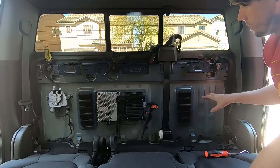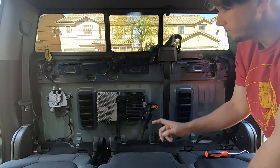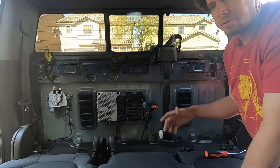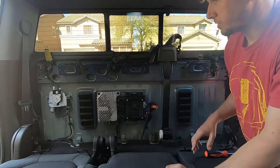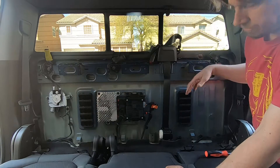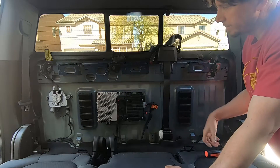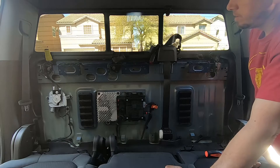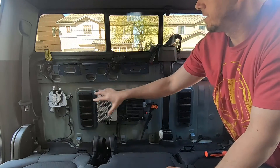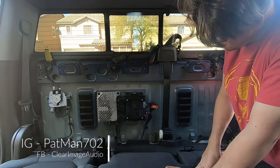I'll do the two amps over here and get rid of one vent — one should be enough. Those flaps are for when you close the door so you don't get that ear-popping pressure in the vehicle. They stabilize the pressure, and they all angle down so if water gets in between them it just drains underneath the truck — no water intrusion. Glad the slide only has a small motor over here and not all the way across — that would have been a pain.